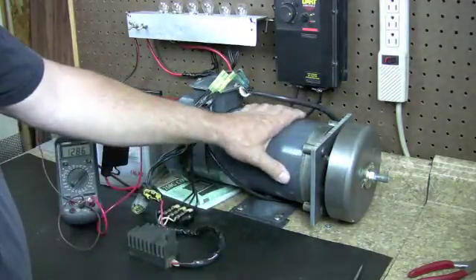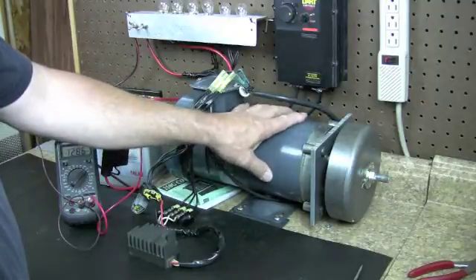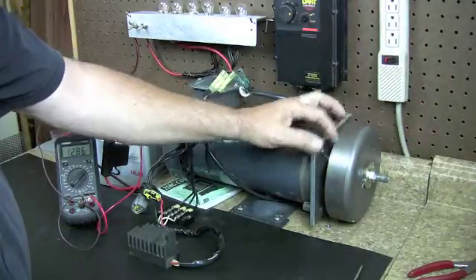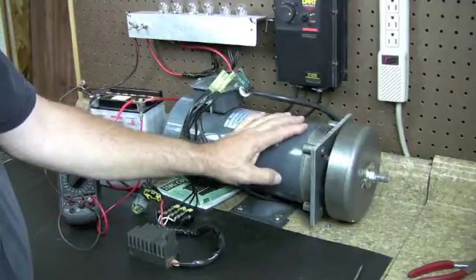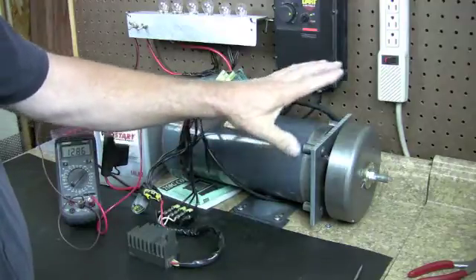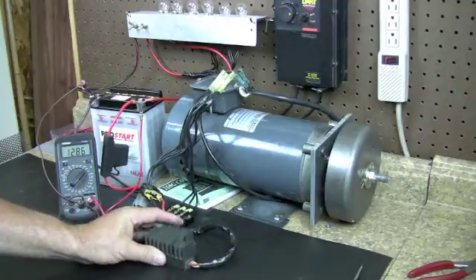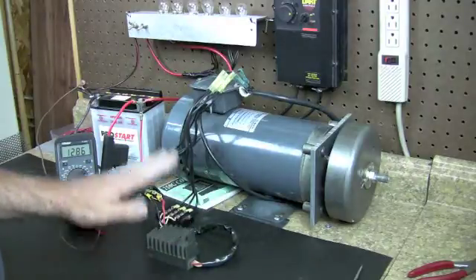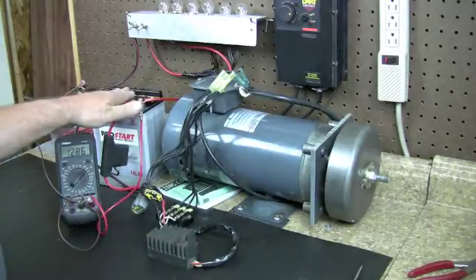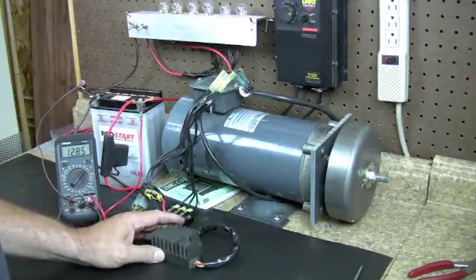You have your motor — I'm using an electric motor in this situation, but say this is your motorcycle's motor. Inside here is my stator, and this is my permanent magnet that spins around the stator to create AC power, which is alternating current, the same as in your house. It creates AC power, goes through your regulator rectifier, which changes the AC to DC to charge your battery, and it also regulates the voltage so we don't have an over-voltage and destroy your battery by boiling it.